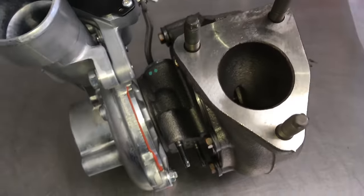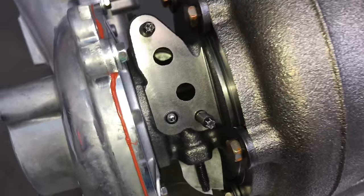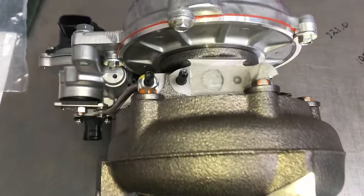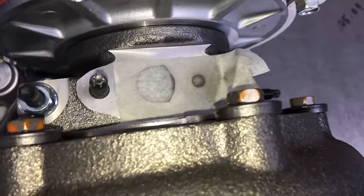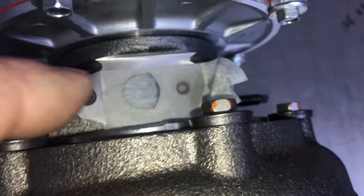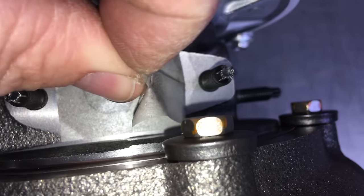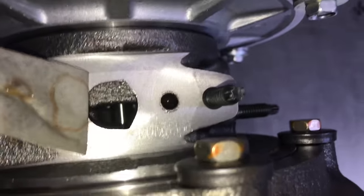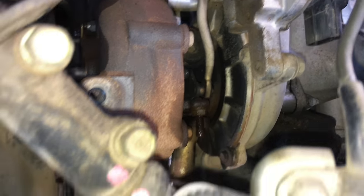There are your oil supply and oil return holes. Just to clarify: the two same-size holes are coolant — don't worry about those, they'll get coolant when we fill up. The oil supply and return are taped up — the small hole is oil supply and the large is the return. Removing the oil supply bolt at the top that goes to the block, and the return line. Also removing the studs out of the bottom of the turbo to get the pipes clear.